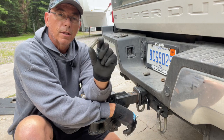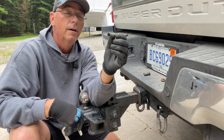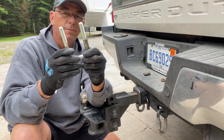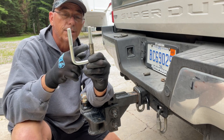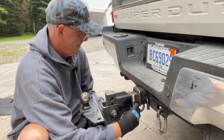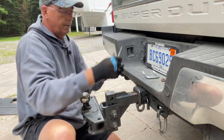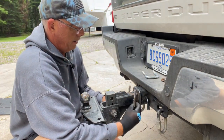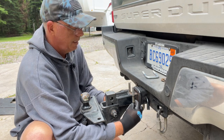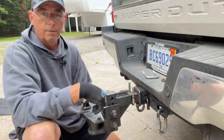What I came up with was these little sleeves. This is just a steel sleeve — bought at Tractor Supply — and it fits onto the bolt. It's only maybe a sixteenth of an inch thick, so total it's about an eighth inch on both sides. You put this little sleeve in there on each side, and then when you put it up here it doesn't rock as bad. It gives it the support it needs, and when you bolt it on and push the mud flap up against the back, it doesn't rock at all.